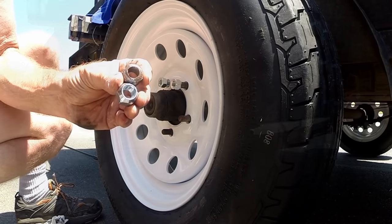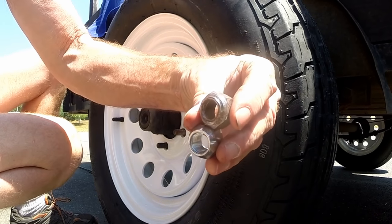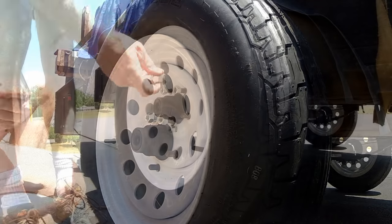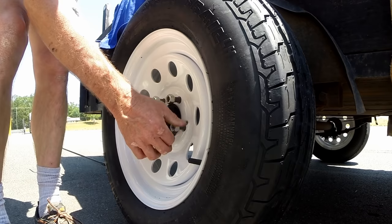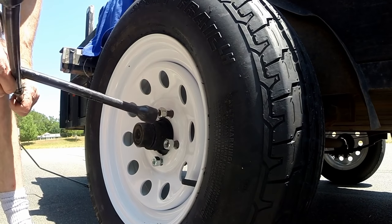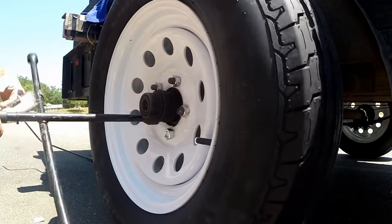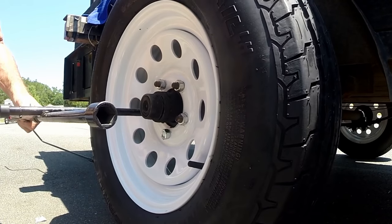So now we're ready to put our new tire on. Apparently that trailer had some really loose lug nuts — you can see how the shiny one is really tapered, but the old one is just totally sheared away. So we really need to just replace those lugs, the lug nut itself, and that should solve our problem. Basically just get these guys started on here and then we'll use our four-way to kind of snug them up, and this trailer tire will be complete. We're on to our last lug — go ahead and spin that on there, get it good and snug.